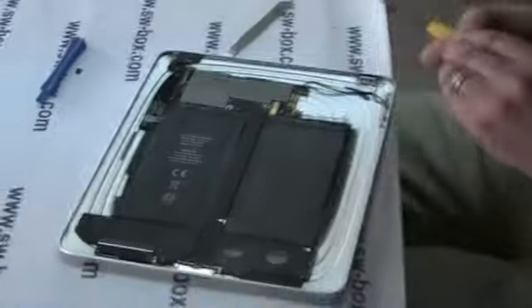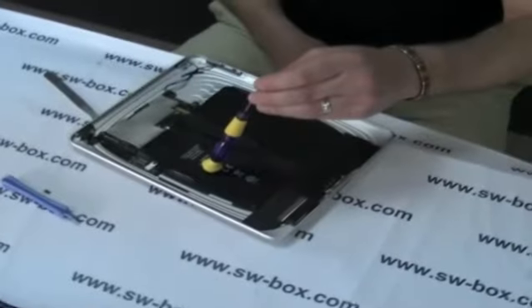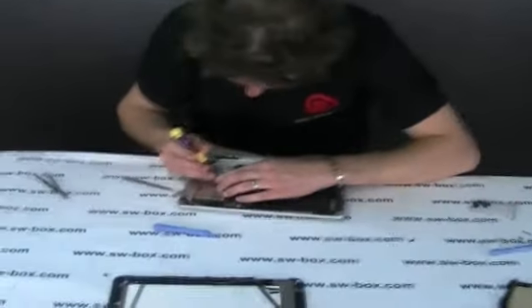Sorry to get in your face here — it's just that our viewers at home really want to see and experience everything you're doing because they love their iPads and probably if you're watching this video, something's wrong with your iPad and you want it to get better. Well, none of it's unfixable from what I've seen. Most of the spares you can get yourself — if you've got a problem with it not charging, it can only be one or two things. Nine times out of ten it's the battery. It can be the charging port — so it's worth having a look and changing that before you change your battery.